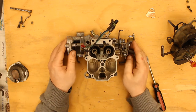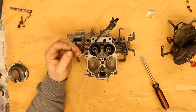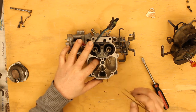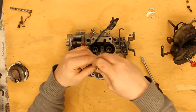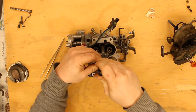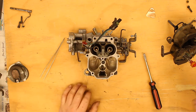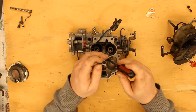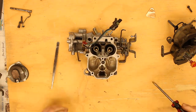That's in, and I also took my jets out to clean them. I'll go and drop those back in. These can be difficult to put back in — do not cross-thread anything. And make sure they don't come loose either.